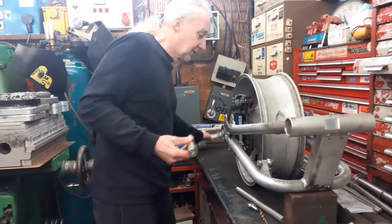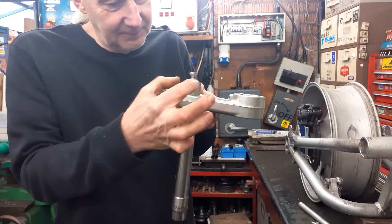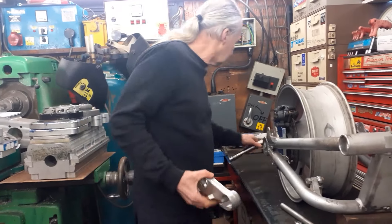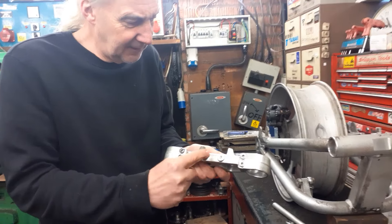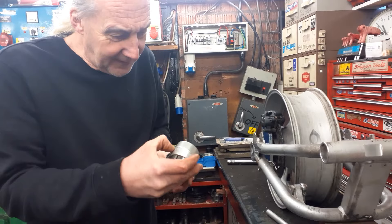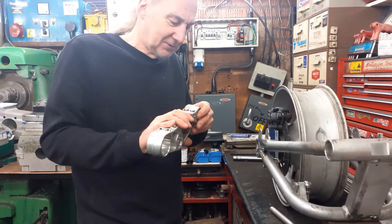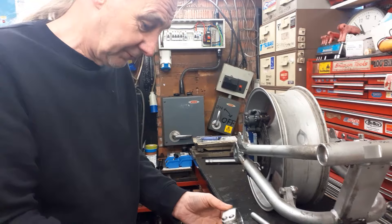Then that'll go in. Looking at what's on the bench, we've made a good start on the bracket — it still needs shaping, and I've had to file it round by hand. I've left it wide here to balance it out, and you can see the lines drawn showing where it'll be taken down. Over here we've got the bar, and that'll fit there. It looks a bit big at the moment but we'll machine it down, tapering it in the middle to about 15mm. The frame has already gone off to be powder coated, so that's a bit late for any changes. I might try a different kind of finish on this bracket since it's aluminium — maybe Cerakote or ceramic coating, quite hard-wearing, just in case the chain hits it. But I've not decided yet; depends on cost, because Cerakote costs an absolute fortune.